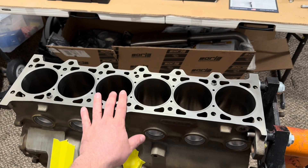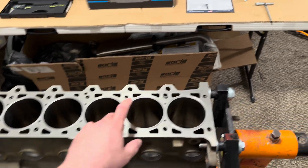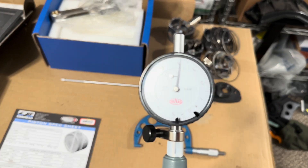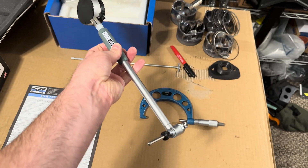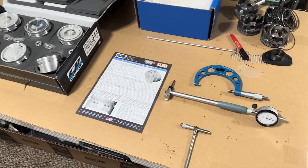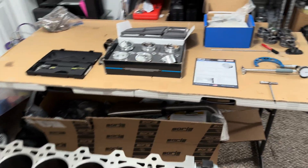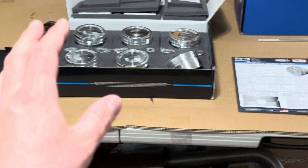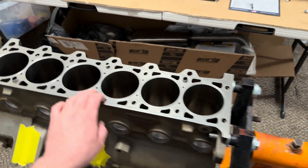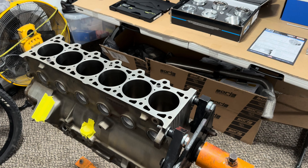Just a disclaimer: I'm not a professional, but rather than just taking the machine shop's word for it, I bought a simple dial bore indicator from Shars and it seems to be a pretty decent one. I'm going to show you how I measure these up and we'll make sure that they're correct when we go to put this together, because taking the machine shop's word for it on some expensive pistons and expensive work isn't always the best — we always want to double check.